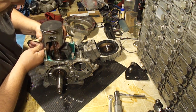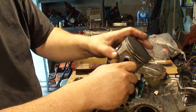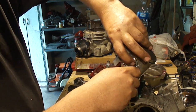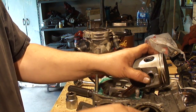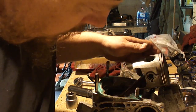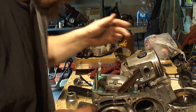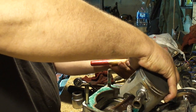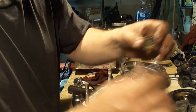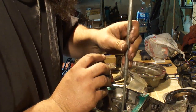Just checking the connecting rod bearing for play. I'm gonna go ahead and take the piston out. There's a little snap ring in here — you gotta be real careful this thing doesn't go flying across the room, and try not to damage it. If you don't have another one to put back in, you'll have to reuse these, so be real careful. And I lost it — went somewhere, I don't know where. It may have fell down in the crankcase. I'm going to try to fish that clip out of there.